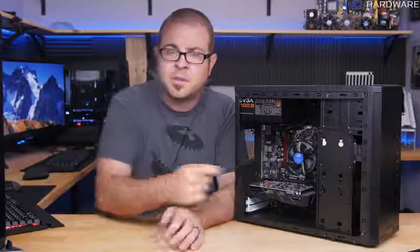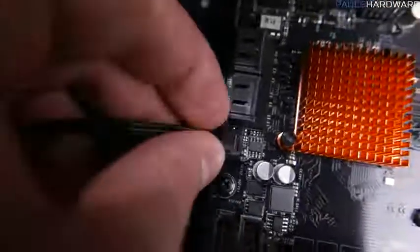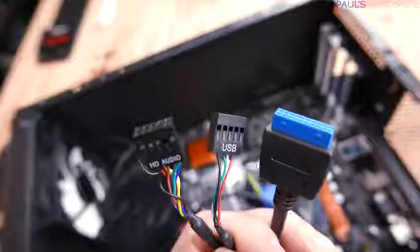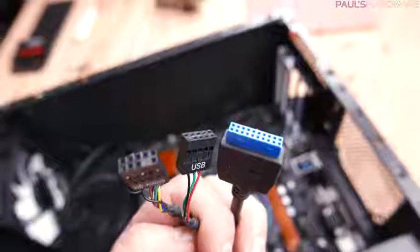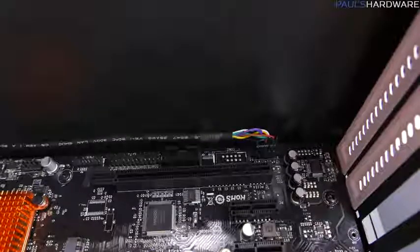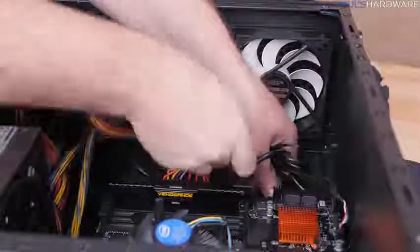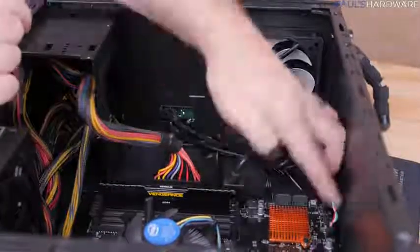This case has one fan with a three-pin plug that connects to the chassis fan header on the motherboard. Then plug in the USB 2.0, USB 3.0, and front panel audio connectors — the USB 2 and audio plugs are keyed differently so you can't mix them up, and each has a specific labeled spot on the motherboard. While you're at it, tidy up the cables at the front, gather them into a neat bundle with a twist tie, and keep them away from blocking the front intake fan. Make sure twist ties have no exposed metal that could cause a short.